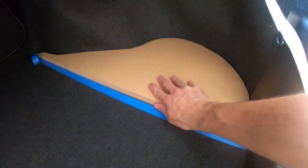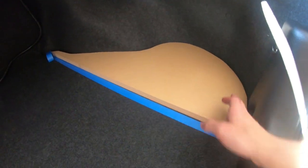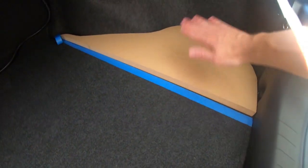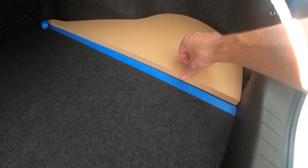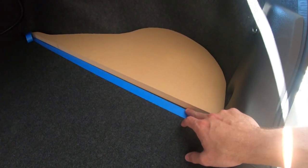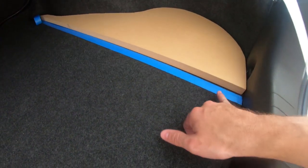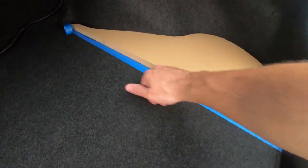So next thing, I'm gonna get a sander out, and I want to bevel the outer edge on top here. So when I start to stretch everything over it, there's a nice smooth transition and this hard edge isn't evident. And then I'm gonna try and notch the bottom half under here so I can staple into it and not have a whole gobbly mess up here.